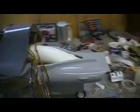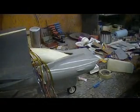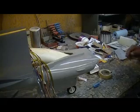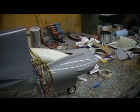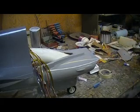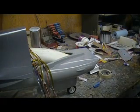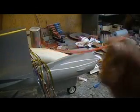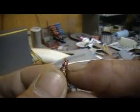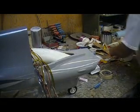I thought I'd show you guys how I found these air leaks. Some small air leaks can be really hard to find. That's how I ended up finding the one on that air cylinder and another real small one. Guess what it was? This was a real slow one. Bam, one of my T's. Everything was on this orange line, even this T, because I didn't find this T until after I replaced it with that red line. The red line's what I used to replace this, but it still had a slow leak in it.